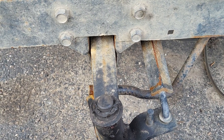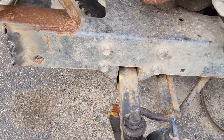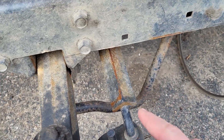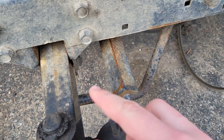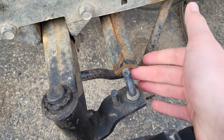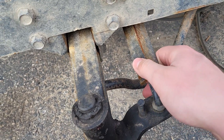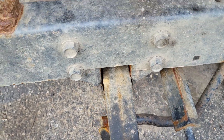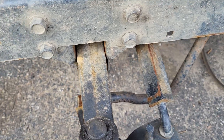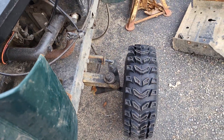I've got a spare front end over there that I can brace up if needed. Another thing that is very weak on these stock Craftsmans is the tie rods. These two things I did a while ago, but I'm covering them now. This is just a stock Craftsman tie rod with a piece of angle steel welded on the top, because I kept bending them, and it works really well. It hasn't bent at all, and it's been smashed and been through a lot of abuse. Another really weak point on these stock Craftsmans is the spindles.